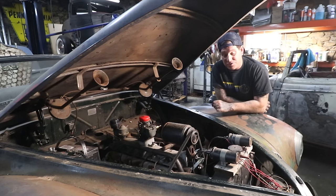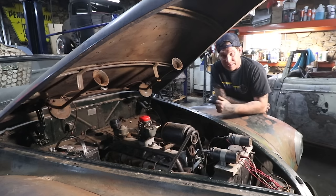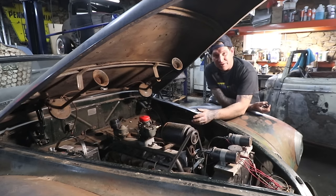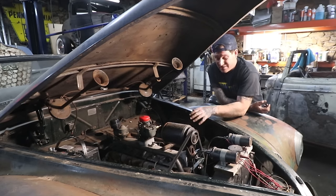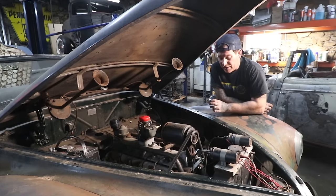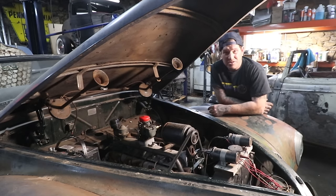Now, I tried to film a quick little video on my phone to send to all my friends, and the thing was very, very hard to start. It sounded like I was getting a lot of arcing off the spark plug wires, but I couldn't really tell if it was that or because the valley is basically open. There's an intake gasket there, but it's kind of open. I didn't know if it was just lifter noise I was hearing, but I tightened up all the spark plug wire clips, squeezing them tighter so they fit on the spark plugs better. It did start again, but not as easy as I would like. So it still needs some tweaking.